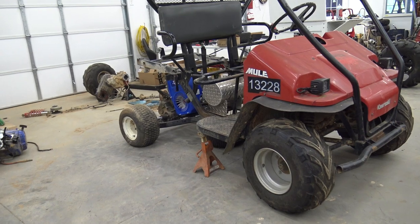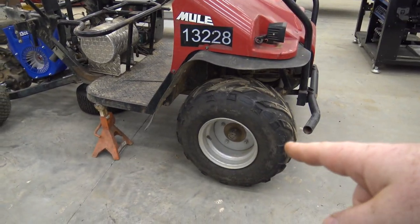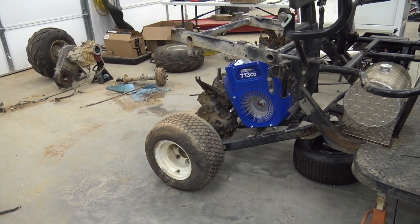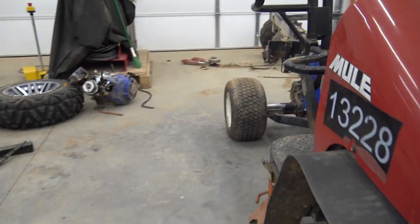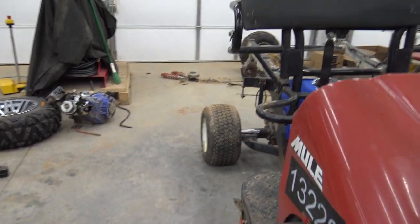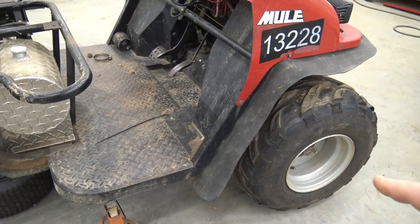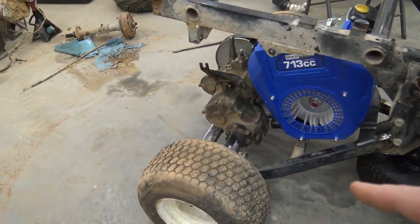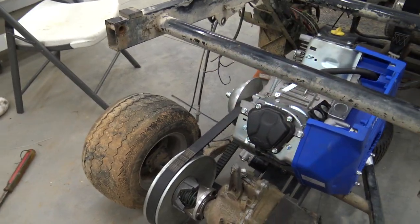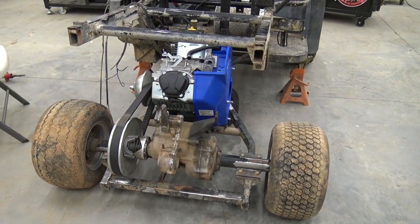Without our wheel adapters in, I can see the front tire is going to stick out past the back. The wheel adapters from eBay for $85 are one and a half inch thick — that'll give us a little more spacing. It is harder on wheel bearings, but it's not as bad as doing it on the front. We have the machine shop making our brake brackets to hold disc brakes on each side. That's going to be super handy, and we can do turning brakes if we don't weld up this diff — tractor-style turning brakes.